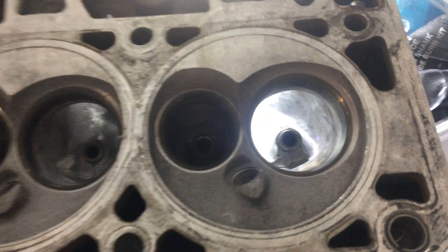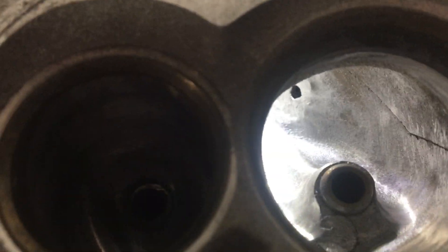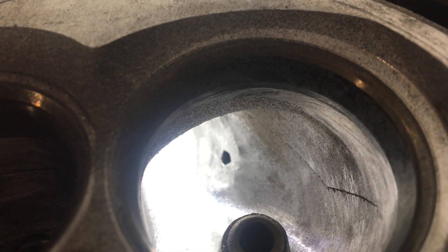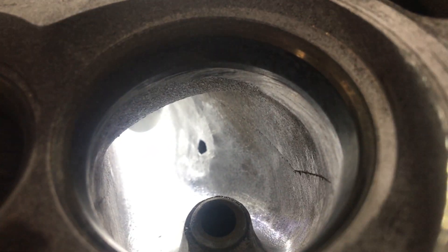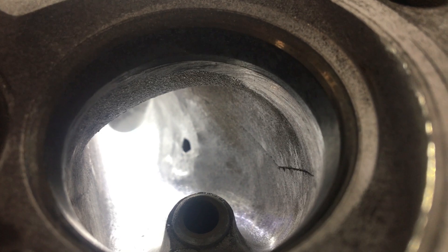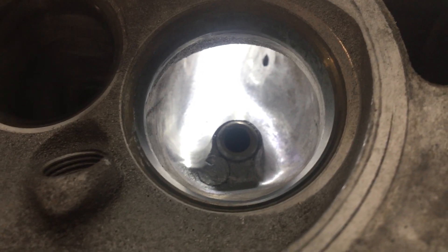Here's some with some light shining in it — it may be hard to see, but take a look there. I took the rocker stud boss, or lump, whatever you want to call it, out, and it made a hard sharp drop-off on the backside which I had to work down and make a little bit smoother to get flow along this wall. Otherwise it was just gonna kind of shoot more straight toward the stem area. You can see I worked this swirl ramp down — that's on the left side of your screen.